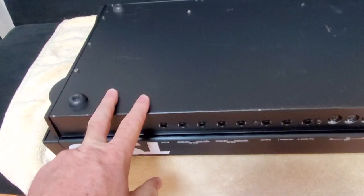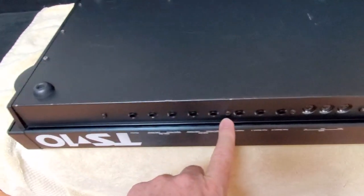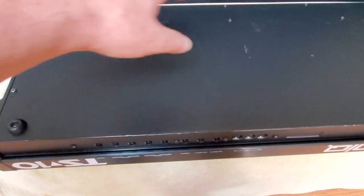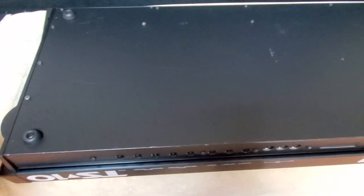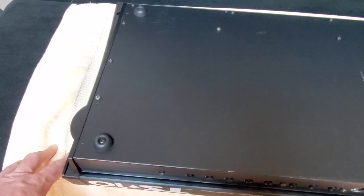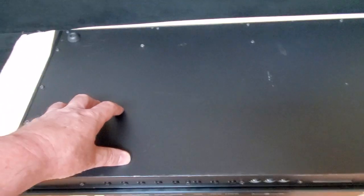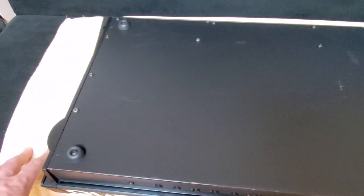First thing is to pull this bottom panel off. You have these screws back here, and then there are screws around the perimeter, and these screws here. Unlike the TS-12, I think all of these screws have to come out. What I do is take them all out in a pattern so I can put them back in the exact same spot, because some screws are coarse thread, especially the ones that go into plastic. Either way, it's good to put them back in the same spot.